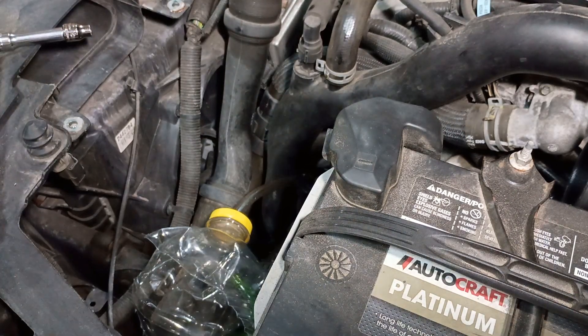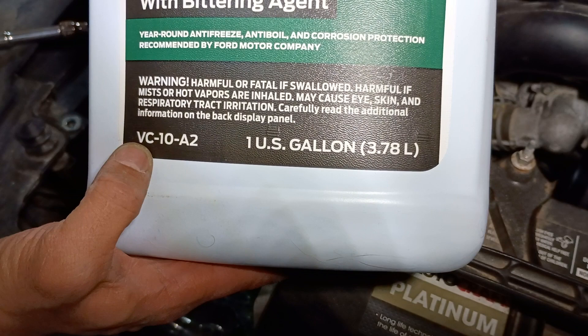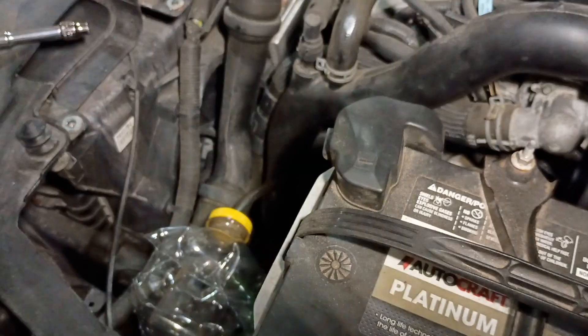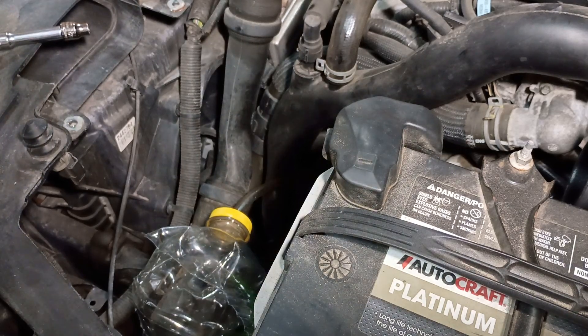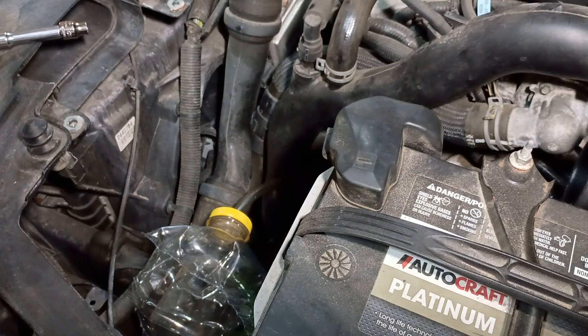I've got the unmixed Ford Green, which is the OEM specialty coolant — this is VC10A2. I'll do 50/50 distilled water. The procedure is: run the vehicle at idle for 10 minutes, loosen the cap up afterwards, and once it cools down fill it, then do 2,500 RPM for 10 minutes. I'm not going to do a video of that, and then I'll check it after a few drives.